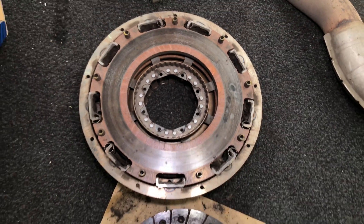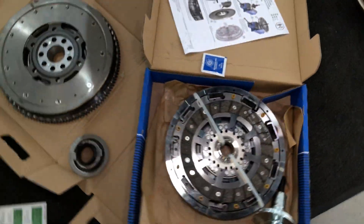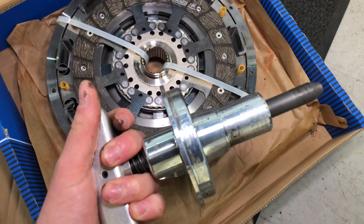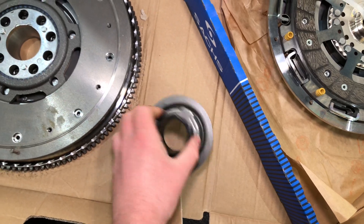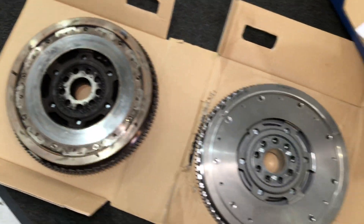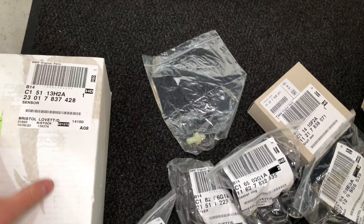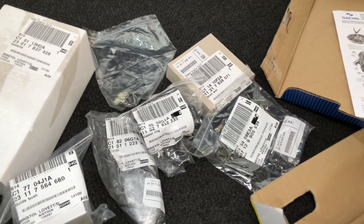So it's definitely a clutch failure and a release bearing failure on this car, so we're going for the clutch and flywheel. Here's the new clutch — the three-piece clutch system — along with the genuine BMW special tool for centering and transporting. We've obviously got the release bearing which comes with it, that's the new flywheel, and here's the old flywheel. The customer also wants a PLCD sensor because these can be a little problematic at times, so we're going for that whilst it's all apart.